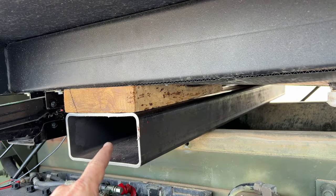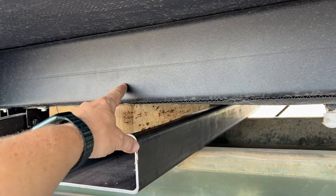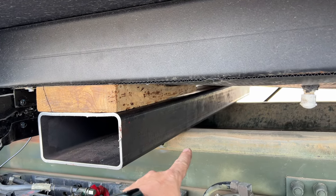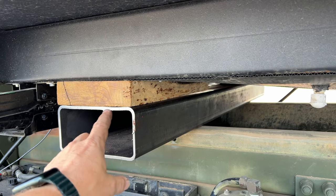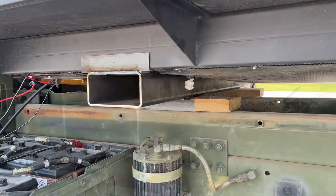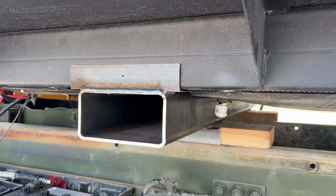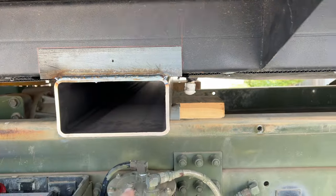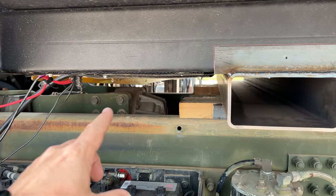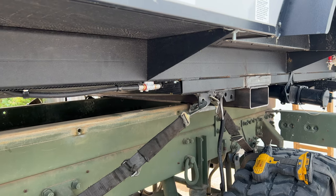On the front of the truck I have a piece of wood above the channel for now to level the camper out. The next step is to weld this up onto the camper frame just like it is on the rear. These blocks of wood will temporarily go between the channel and the truck frame to keep everything level until I can set these channels into the truck frame to level it out correctly. The channel on the front is done now — once it's welded across on both sides I can take the board off, set it back down onto the truck, check my clearances, and if needed cut a little notch out of the frame back here to level everything out.